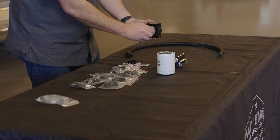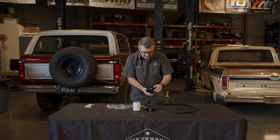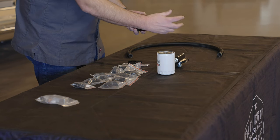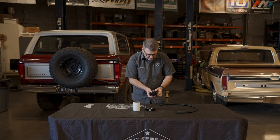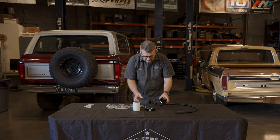There's going to be a hole and you've got this nut here, and you're just going to crank this on, seal this up. These holes right here are going to point to the back of the transmission. You could put it to the front if you wanted, but we usually try to keep things out of the way of the alternator, so this goes to the back.